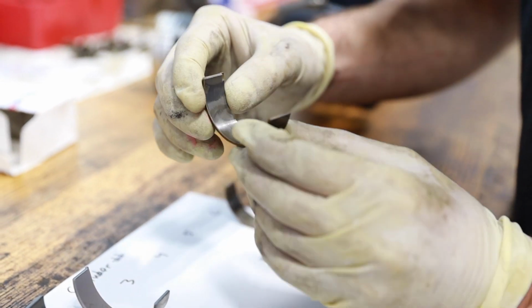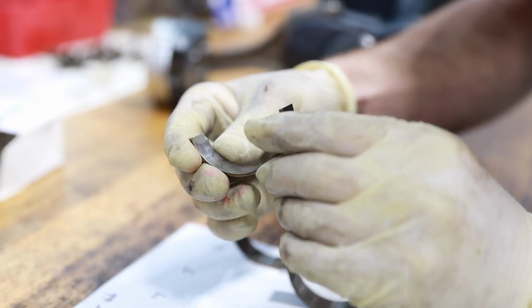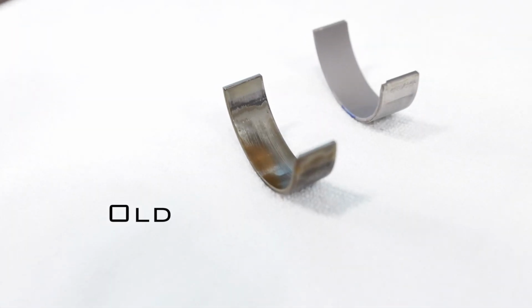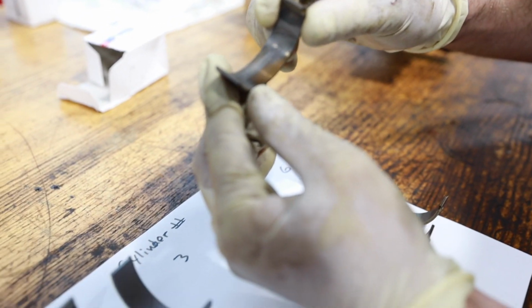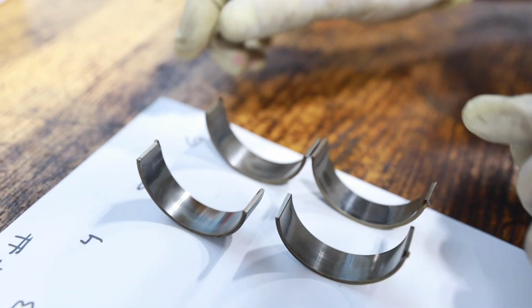Wow. So these bearings are made primarily of a copper base, with a couple of light coatings of lead and other materials on top. Now as it wears, you start going through those upper layers. And once you start seeing that copper, that means it's been extremely worn. Well, hold on, man. I know that from my M3 when we did it, I had some copper, but that seems like a lot. That's a lot. I mean, you can compare it to other ones.